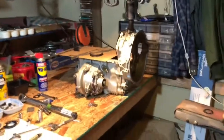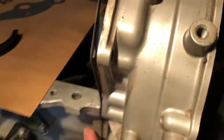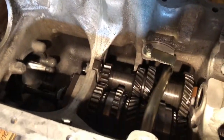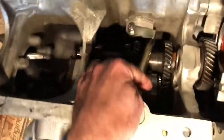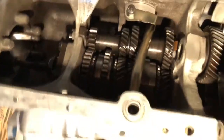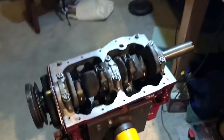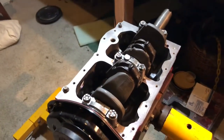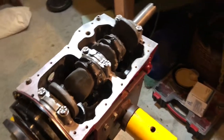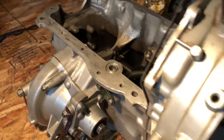I'm about to put the transmission on. I've just dialed it in — I got about five thousandths there or so with the rest of the bolts and such to be installed. This is the actual one out of our green Cooper S — an original Cooper S close-ratio gear set. I went through it, installed a center oil pickup, and ended up changing the layshaft and some bearings, freshened it up. This was a really sweet-shifting setup. I originally elected to run it under the 998, but in the meantime we made some upgrades to our own 1380, which made me think I should put the very strong box under it. This one should work really nicely — 3.76 final drive, has an LSD unit in it, and I'm setting it up with all the larger A-Plus bearings.